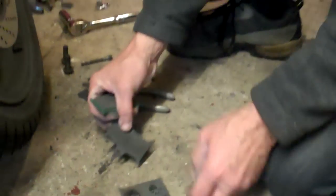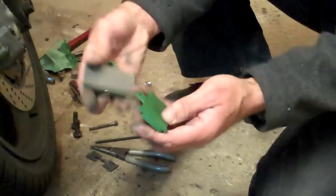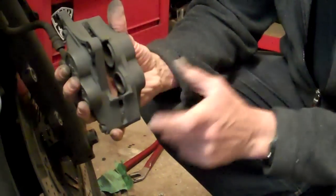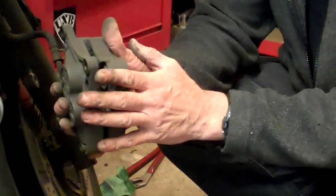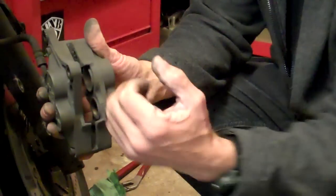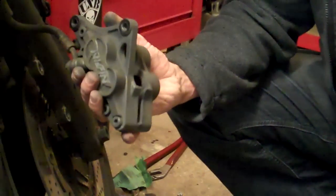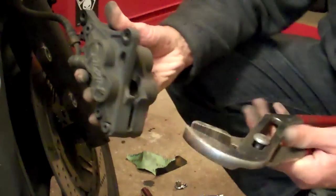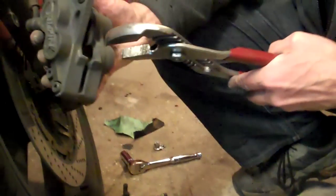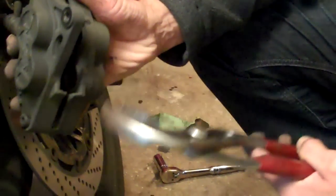They're not sided, not left or right, they're the same. Before we go any further, at this point you spray all your brake cleaner in, toothbrush, clean it all out. And if they're not moving freely — if when you put that screwdriver in and twist it they don't push back freely — then get some brake cleaner in and free them off. If they're not right back, use your big pair of grips, get in there, and you can just squeeze them back that last little bit.